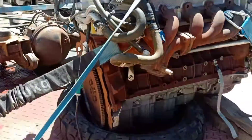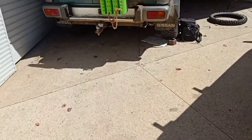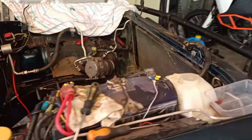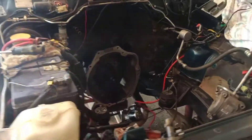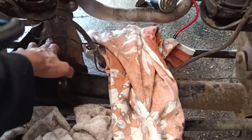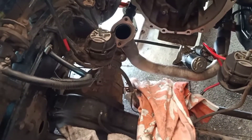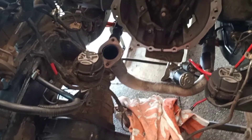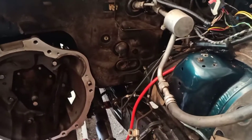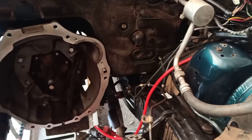There is a bit of work I'd like to do before I drop that straight in. There's a brake line down here that I've had to disconnect — it's all flexy now and bounces around, so I want to make a little bracket so that doesn't fatigue over time and snap out in the middle of nowhere. And there's also a clutch line there — that straight one — I want to put a curl in it so it can flex and won't crack over time.